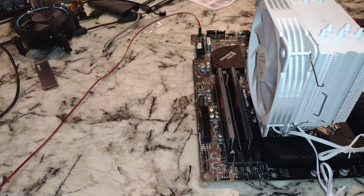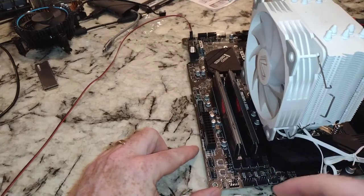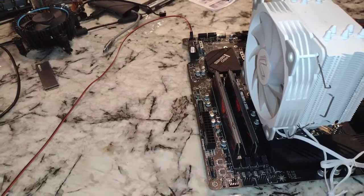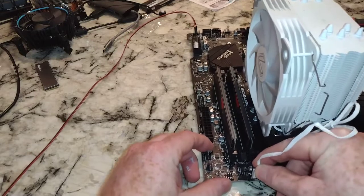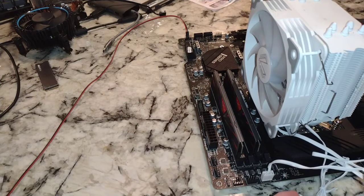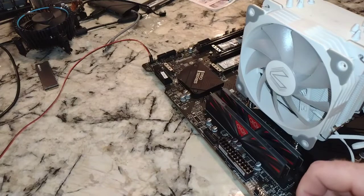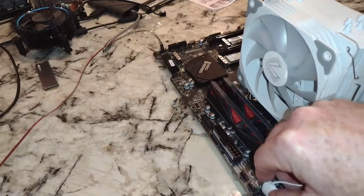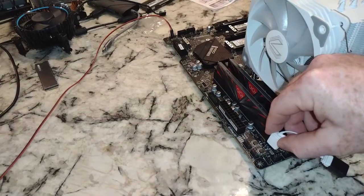All right. Now, if you need glasses, folks, this is where you might want to get them. You want to make sure that you put this in the right location for your CPU fan. And we're looking for our 4-pin right here. And we'll put that right in this spot right here. Now my RGB is over here, and I need to cap my other one. So you could add a second fan to this, it would appear. I don't know if you could buy it from Vetroo, but you have another cable here to connect something else for ARGB. As we're putting this in, folks, on this motherboard, there's my ARGB port. Let's just make sure we're in focus.